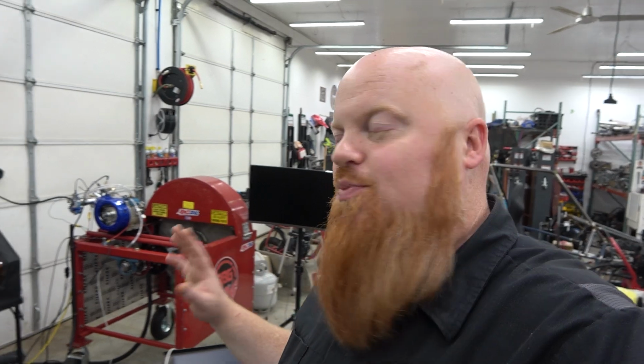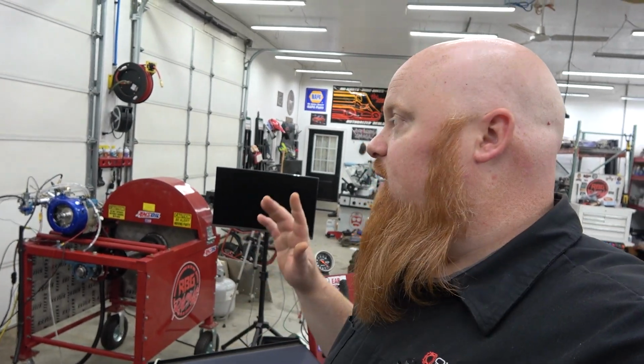All right, so that was pretty impressive. We made 21.23 horsepower and we made 15.5 foot-pounds of torque. Now that's half a foot-pound more torque than my 224, but that's huge gains. That's like 3 horsepower more than my 224. When we got to set, we ran it 3 different times and every time was right around 20. Our highest was 21.23 horsepower and it fluctuated around that, around a half a horsepower less.